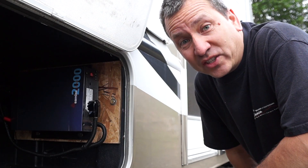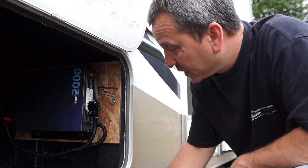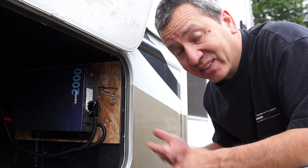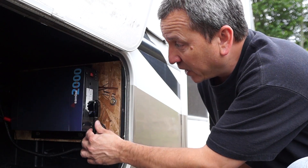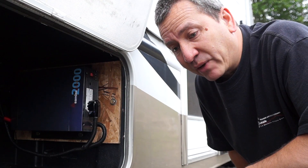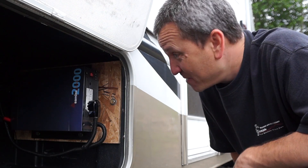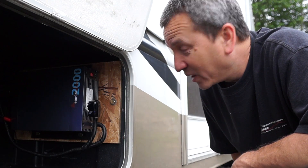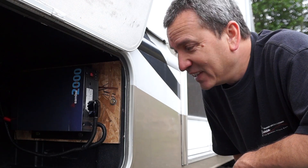I got this all hooked up and I'm so excited. Here's my inverter all installed in this storage bay. Got two connections to it — I have the remote, which goes inside, and the single receptacle here. I wired a plug that runs to the battery bank, which is also where my power cord is. I fired it up and it works really well first time. I'm just checking out all the AC appliances inside.